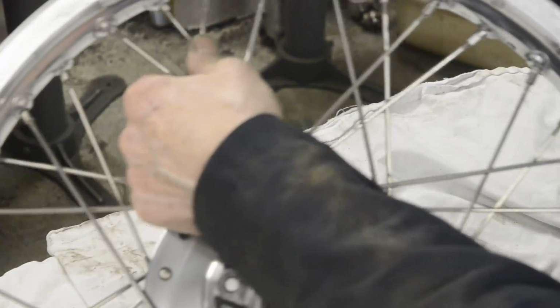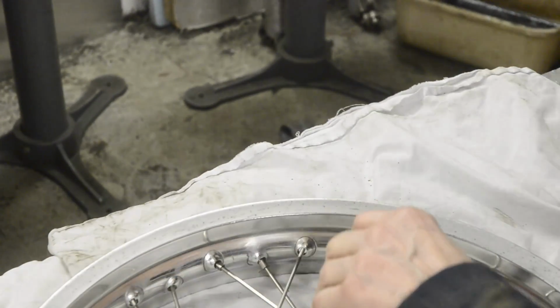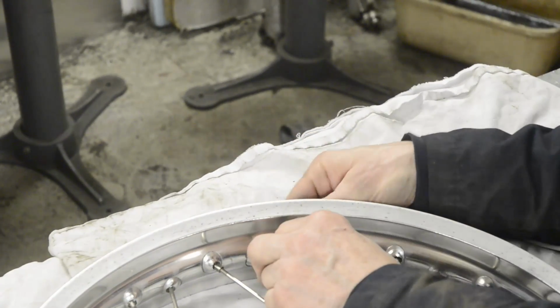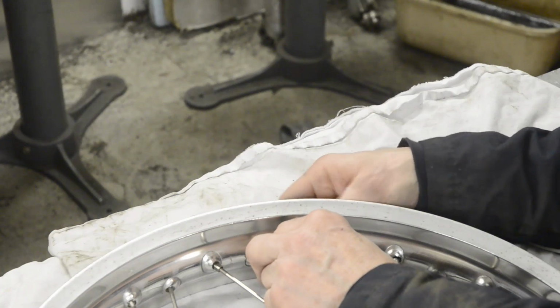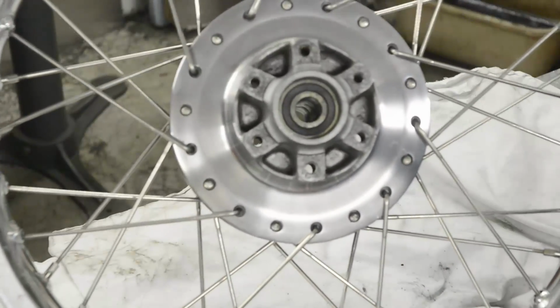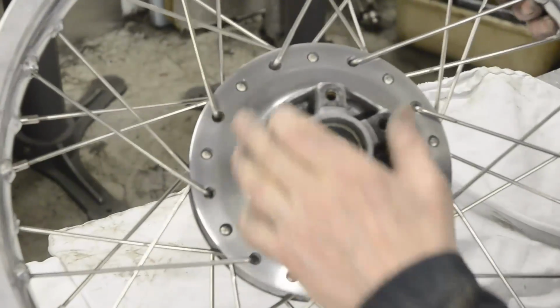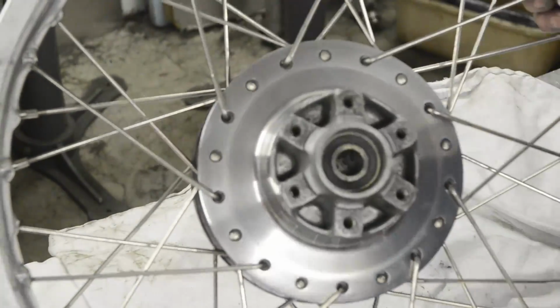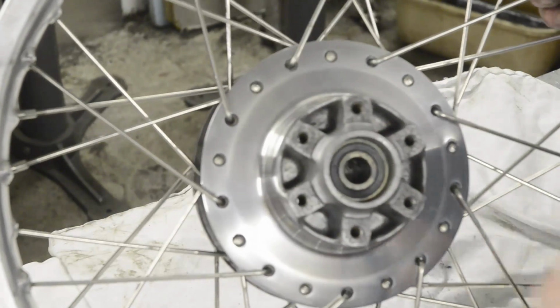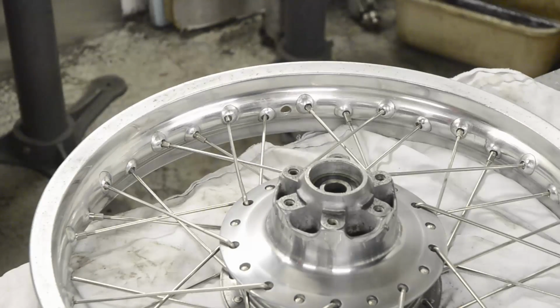Look at that. Can you see now? You joggle it. I don't know if you can see that. There must be a quarter of an inch of space. These things are sent to try us. Okay, there we go. There's our wheel laced up. You can see we're crossing two spokes, so that pattern is right. The inners are going to the left. Everything as per our diagram.